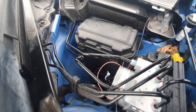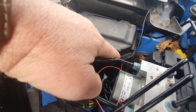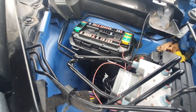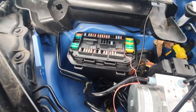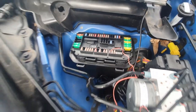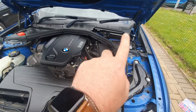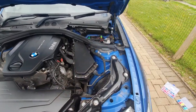I'm halfway through this job already, but there's a clip on the front here and two clips at the back. Push in the two at the front, up it comes, push in those two, and it will come off. You will be left with the fuse box in the bonnet area - or hood area, depending on where in the world you're watching this. If you're in a left-hand drive car, the fuse box will be on that side. We are in the UK, right-hand drive, so the fuse box is on this side here.